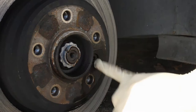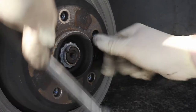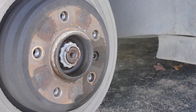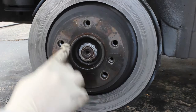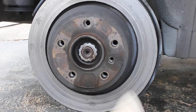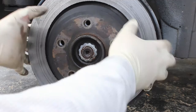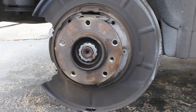The next thing is we have a 6mm Allen socket fastener here. Go ahead and spray some PB Blaster — or liquid wrench — because these can be tough. Mine broke loose right away. Now zip that out and we'll see about removing this rotor. Once you've removed that 6mm Allen fastener, spray some more PB Blaster around there, then depress your e-brake — because if you don't, there's a pad holding on inside this drum section of the rotor. Take a hammer and beat along there to break the connection, and the rotor comes right off.